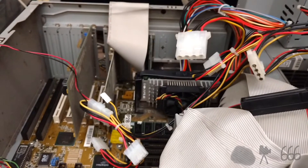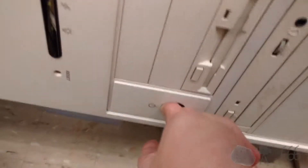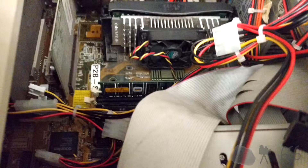Well, it's still got a problem, but that is definitely promising. You get a beep code out of it now. The beep code in question on an AWARD BIOS indicates that the memory is bad, or that it's in an inappropriate configuration. I went ahead and changed the memory configuration to something that should hopefully be a little bit more valid.